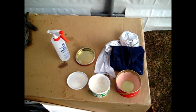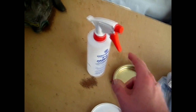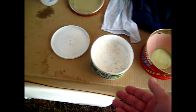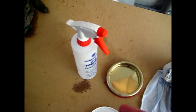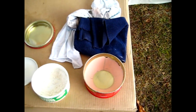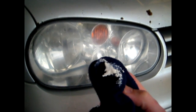Now for the final stages of your polishing process. What you'll want is polishing compound with just a little bit of water — it doesn't have to be in a spray bottle but it's a lot easier that way. After applying the compound for some time it will dry out, so just spray some water to re-moisten it. I also have some car wax here — carnauba wax, though any wax is sufficient — and a couple of soft polishing cloths. I've already applied some polishing compound to my cloth and I'll apply it in similar movements as sanding.